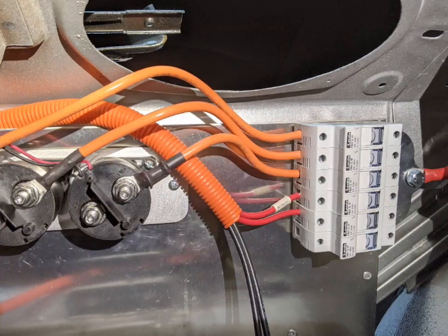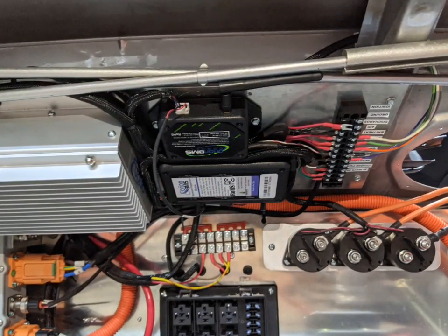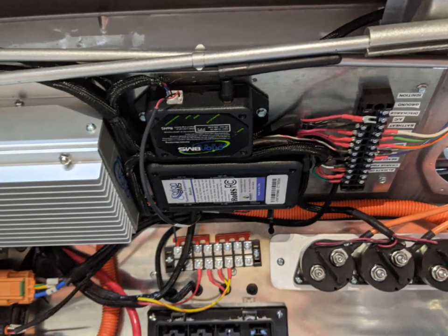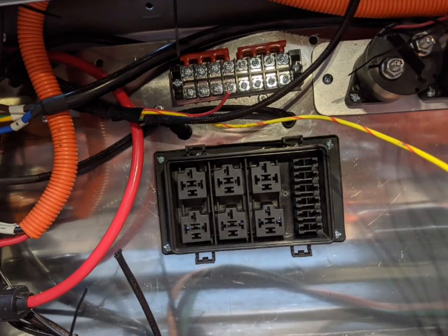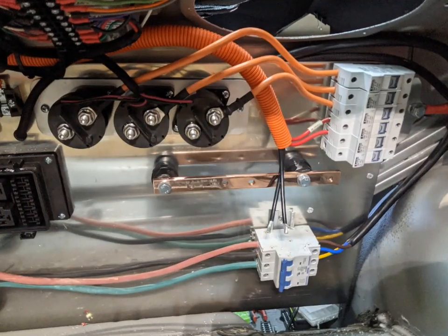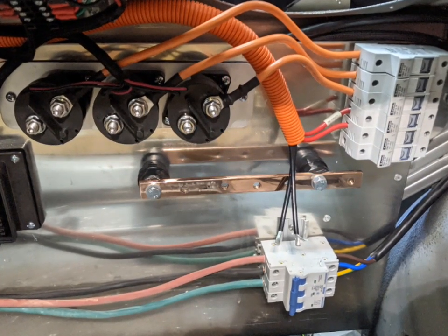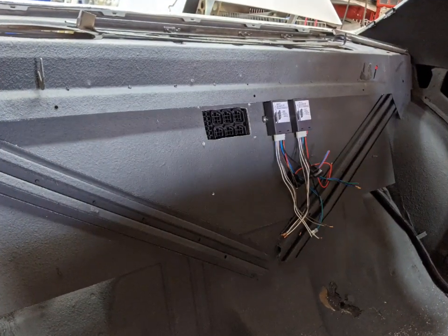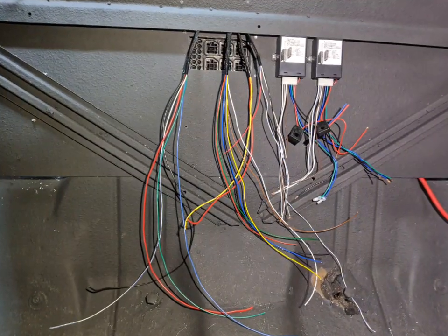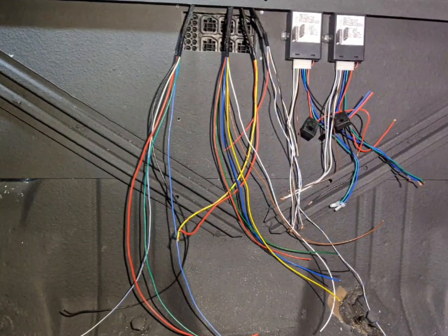Here's what it looks like mounted. Three of those fuses — the heater core, the battery heater, the air conditioner — and then we also have the charge wire coming back into it, and the DC-DC converter which will go through the charger to charge the 12-volt battery. Everything's starting to get wired a little at a time. I also need a fuse block and a relay block, so this is on the same panel — a big sheet of aluminum mounted behind the back seat. There's a big bus bar for the negative, all the returns for all the components. The backside of that aluminum has been lizard-skinned like the rest of the interior. I've got my two power window modules — those are actually for the parking brake — and the back of the fuse block I need to wire, passing through all the different wire harnesses I'm tying together.